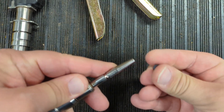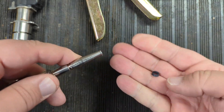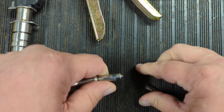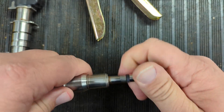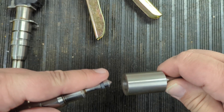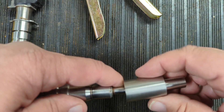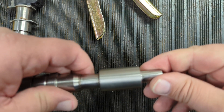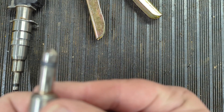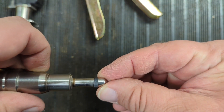We already have another video on our channel on how to replace the combustion seal, but since this comes as all one package, we might as well show you here. You get a cone that slides over the tip of the injector, your seal goes on top, and you're basically just sliding the seal up and removing the cone. This part of the tool has a cone shape inside which allows you to push it onto the injector and start compressing the seal. You may have to push it a couple of times to build pressure, then let it sit for about 60 seconds, and your seal will be compressed around the tip.